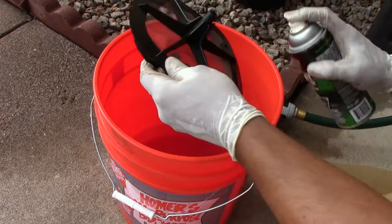I'm going to go ahead and use it on this, then just dip it in the bucket. That looks pretty good. PJ1 foam filter oil treatment spray — that's what we're going to use. Shake it up really good, then knead it and work it into the foam. All right, we've got our filter cleaned and oiled.